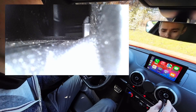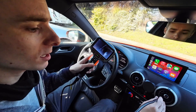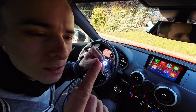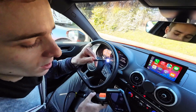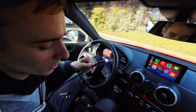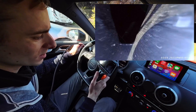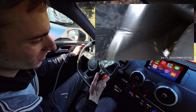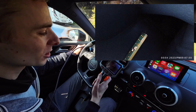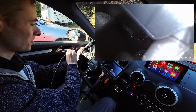On the display we can see a temperature readout from the camera tip, but since we are using LEDs on the camera tip, those LEDs make the tip a little bit warmer, so this readout is not the ambient temperature but the inside temperature of the camera unit. You also need to be careful in some vents — there's a small electronic board, the temperature sensor of the air output, and we don't want to damage it. Going through the left vent to check the system is not a good idea.